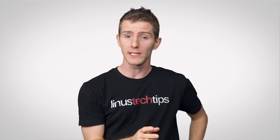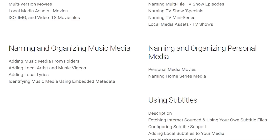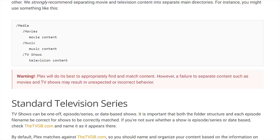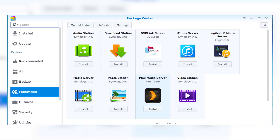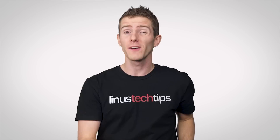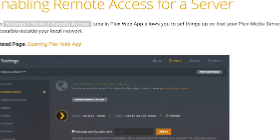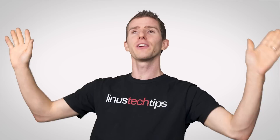But you don't want to just dump your files onto it willy-nilly. Instead, make sure to organize your media into a folder structure that breaks your TV episodes down by season, or your songs by artist and album. Popular media server software like Plex will provide instructions online about how best to do this. Your next step will be to download the server software through your NAS or web browser, and the client software for your devices from the appropriate app store. This will allow you to easily access your media — kind of like your own personal Netflix. Plex is a very popular option, although others such as Kodi and Emby are also fine choices. Configuration after this point is mostly a matter of following the on-screen instructions and opening up some router ports for remote access.